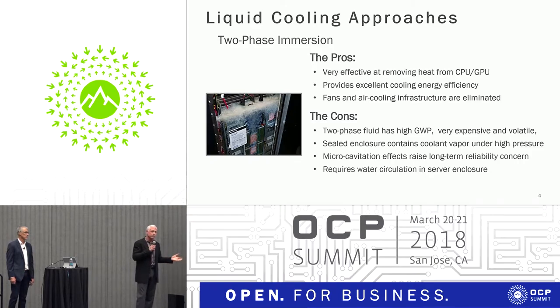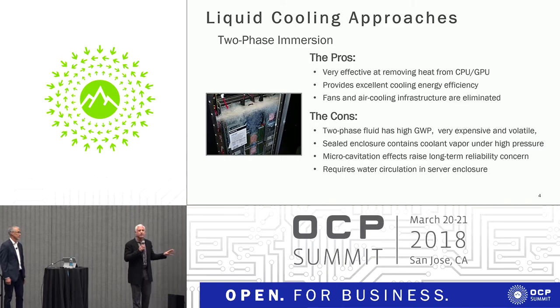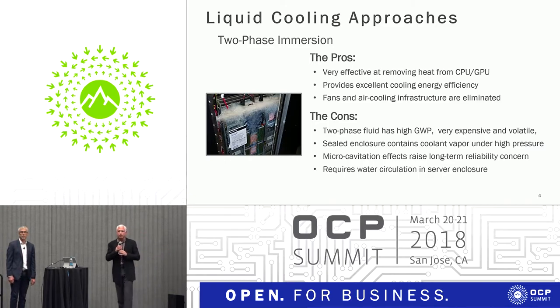We actually have a number of customers, primarily bitcoin miners, who have a lot more experience with this. They're finding that the dielectric strength of their coolant radically decreases as the number of microscopic metallic particles in the coolant increases, forcing them to replace the coolant. The coolants for two-phase tend to be very expensive. So outside of the tremendous health hazard, we also have the fact that we're essentially eating our devices alive — these make for two very difficult problems.